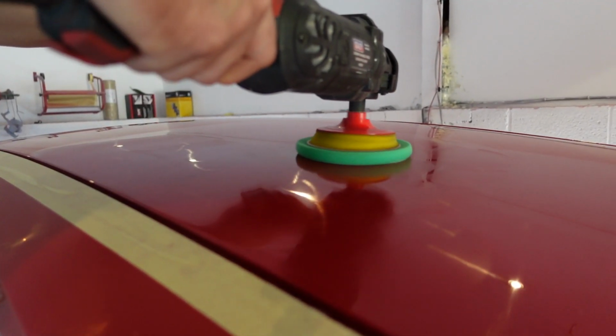Right, Big Neil, what have you been up to then? You've been busy getting this looking pretty good? Yeah, it's all been going for sure. Last time we saw it, we lacquered it, four coats of lacquer on it. Now we've wet flatted it, 1500, then 2000. And we're now onto the polishing stage and picking any last little bits of muck out of it.